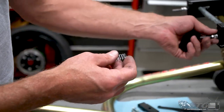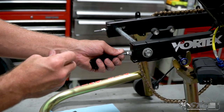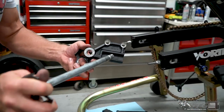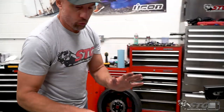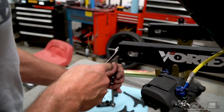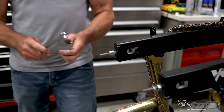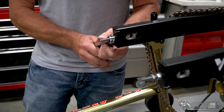They include a spring that goes on the other side of the chain adjuster to help keep it tensioned so you don't see it wiggling around. I need to pull the rear axle out and I'll show you how to put the tire back on and all that good stuff. I'm also going to need to use the Pitbull jack stands to support the bike by the rear sets, because we're going to have to take the spools off to facilitate this install. So that's something you want to make sure you keep in mind.